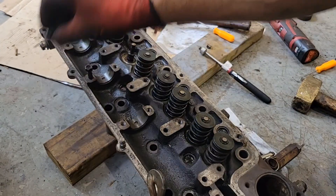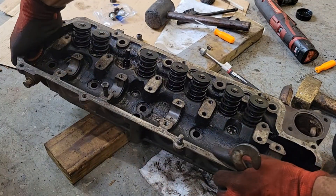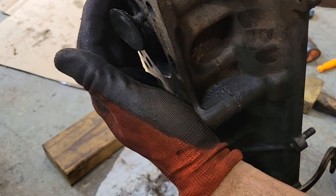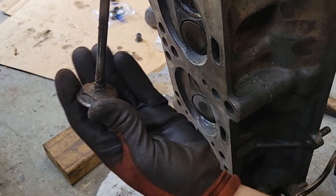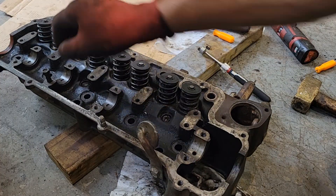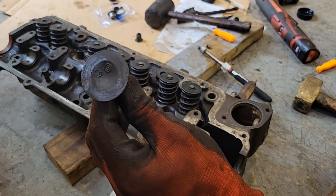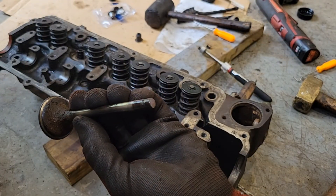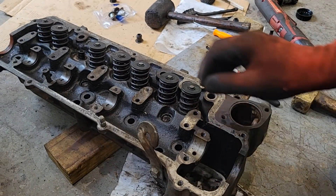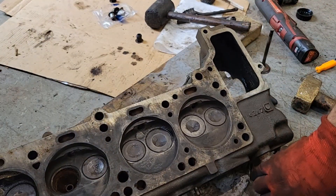I'm also going to push the valve out — push this side and watch it pop out. There's our valve. I want to clean the spring seat and clean the valves. Valves aren't terribly expensive, and you'll save a lot of time if you have a new set — it takes several minutes to clean one valve with brushes, picks, and solvents. Next step: clean, clean, clean, and we're also going to clean the other side where the valve seats.